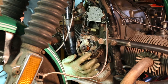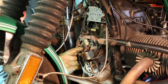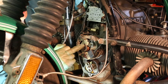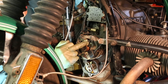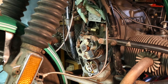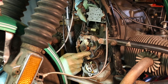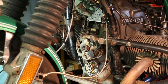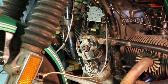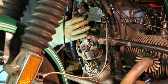We've got the stator around the outside. What's poking through is the rotor of the alternator, bolted directly to the end of the crankshaft. There are two slip rings just here under my finger and the carbon brushes which connect to those slip rings are just above. On top of the alternator up here is the diode pack. It's a three-phase alternator with a three-phase diode pack. This is the thing which gets rubbed against if you bring the cover down carelessly, and it can get damaged if you don't disconnect the battery.